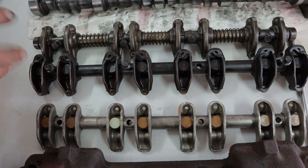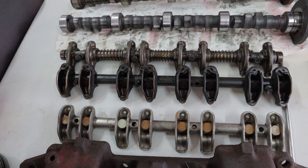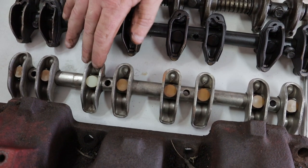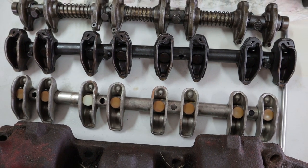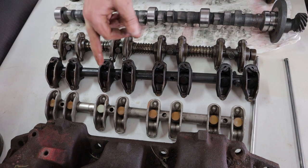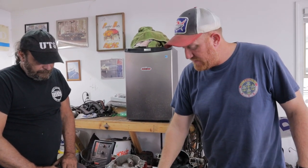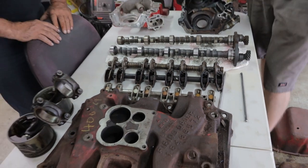You definitely want to look at the rocker shaft when putting one of these engines together — make sure it isn't bent and not cracked. Once they start to wear at the end rocker, that's the first place it'll break off — it'll cut a real sharp groove in there, just like you machined it. When it went to the stamped steel rockers in '72 and later, they're much more rigid. The ratio on the earlier cast rocker is about 1.55 or 1.50, while the stamped steel rockers are 1.59 to 1.61 — more desirable ratio-wise. But weigh them: the cast rocker is so heavy. Valve train weight is a big deal in a racing application. The stamped steel rockers are about 13 grams lighter.